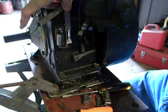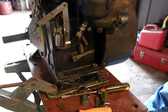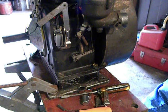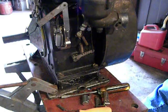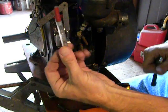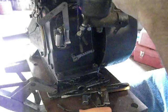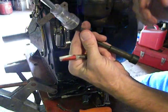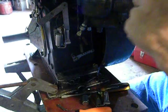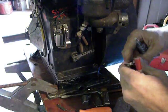I've got it set a little tighter, actually at about 18 thousandths right now — and that's where I got my hottest spark. Another good thing to have when you're trying to set your points, if you don't have a dwell meter — which is kind of old school — there's a new school way to check if you've got good spark before ever putting the button and everything up. One is an ignition tester, typically used on automobiles — you put this on there as you're turning it over and it will light up. The other type goes in between the coil wire and the spark plug and it lights up also. You want to check for the hottest spark you can get, so your gap may go up or down as much as two thousandths in either direction.